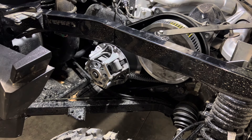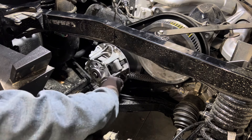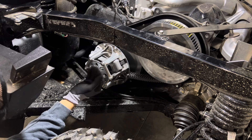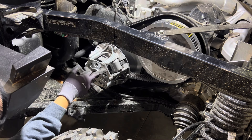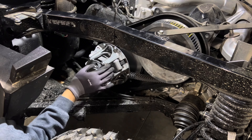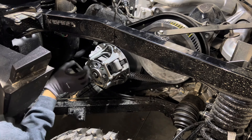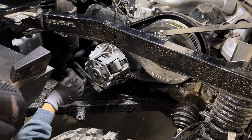Our primary clutch is the front clutch here. We have these 12 millimeter bolts — six of them — holding our overdrive clutch cover on. What that does is space the cover out a little more to allow the clutch to shift further, because factory does not shift far enough. The overdrive clutch cover is something I highly recommend. We also have overdrive washers which space the OEM cover out, but the OEM cover is weak — we actually broke one after installing and reinstalling a few times. This cover is a lot stronger and adds rigidity to the outside of the clutch.